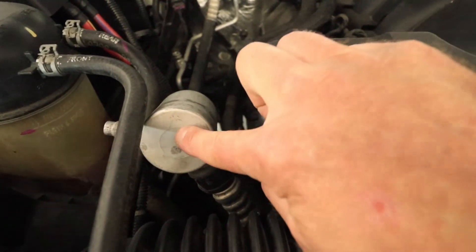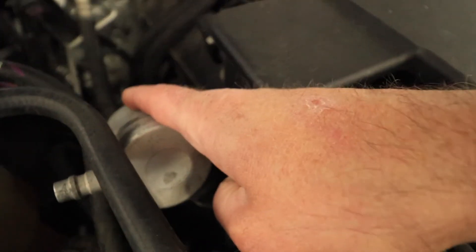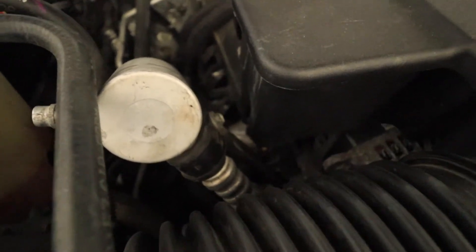One of the things I might look for under the hood on a performance check is the suction line — the low side line going into the compressor. This line should be cool or even creating condensation because it's so cold. On this truck, this is my low side connection and service port, and when I touch it, it is cold to the touch. This should be a similar temperature to what my vent outlet temperature is, and that gives me a sign the system is working okay. Checking the suction line temperature is a good way to decide if the whole system is working properly — if there's an issue with an orifice tube or expansion valve, the whole system is not going to function well and I should see that on that line.